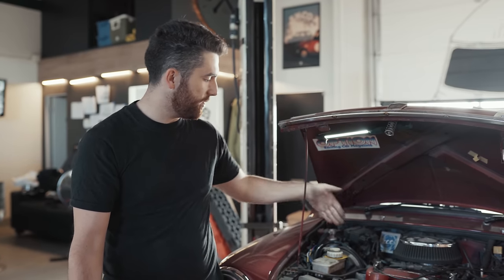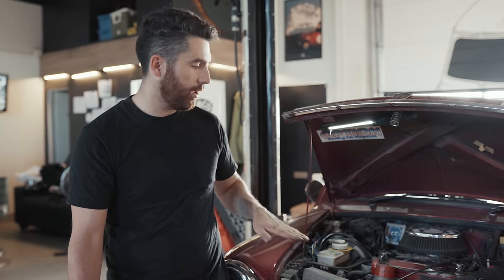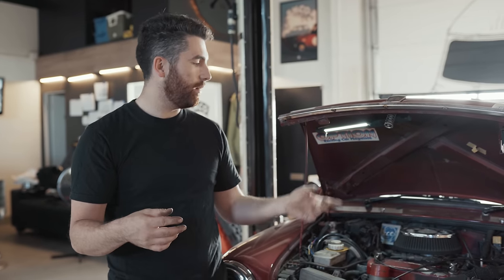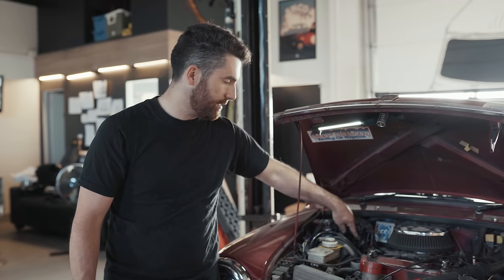What you will have is a booster that's mounted here, and then a master cylinder. The master cylinder sits horizontally, not vertically like on the other systems. This is what's called a green tag master cylinder, mounts to the booster. Because of the way the booster sits and the space that it takes up, they had to put it horizontally. And because of that, you have a linkage system. So instead of the pedal going straight up and pushing on the master cylinder, it has to go through a linkage system to turn it sideways. You can see it on the backside here, with these nylon bushes that turn the system, and then it goes to the booster, and then it goes to the master cylinder.